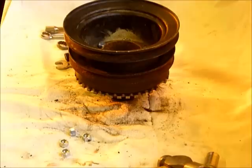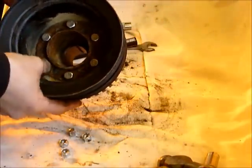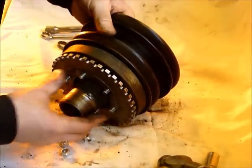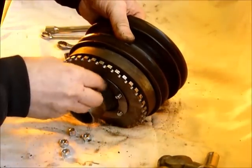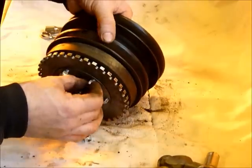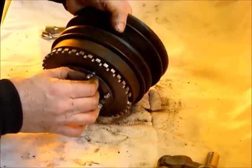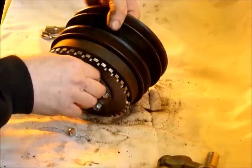The best way is to put all six bolts in so they're completely through, and then carefully turning it over, put the nylocks loosely on the back. If you try and do one bolt and tighten it up you'll find that the tolerances are so fine you won't get all the other bolts in, so it's pretty essential that you go bit by bit working your way round.